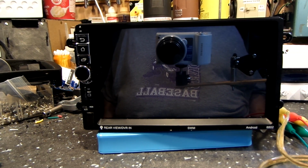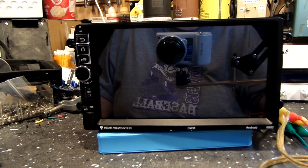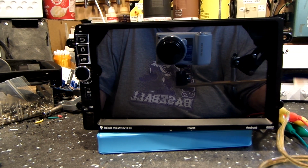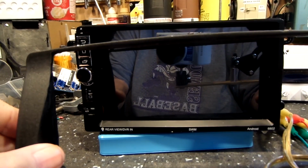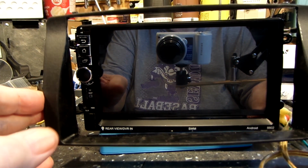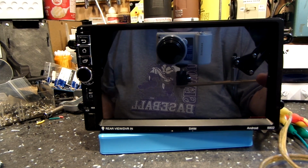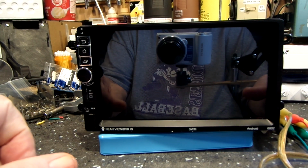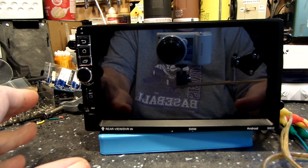Well, good morning, YouTube. Here with you at the bench once more. As you can see in front of you on the bench is the new Android head unit that I had in the car. It did not work exactly right in the car. I've already checked this. When I brought it in first, I still had the bezel on it, and I did the test with that on there, and it worked fine, no problem at all. So it has something to do with the spacing around here, the tightness around here probably, putting it in a bind, maybe pushing on the screen, I don't know. But whatever it is, that will be fixed.